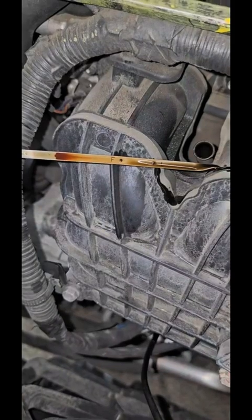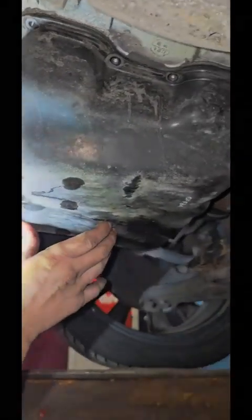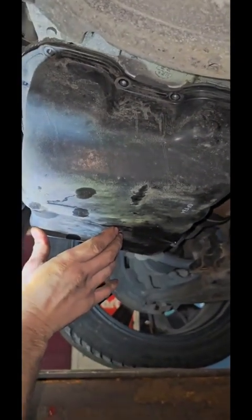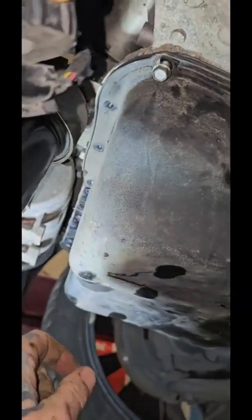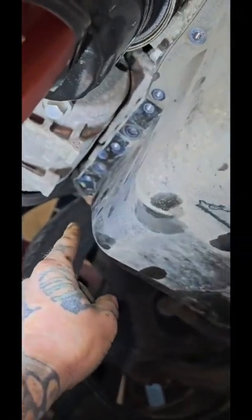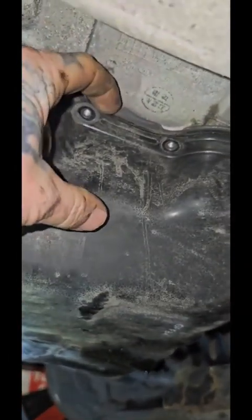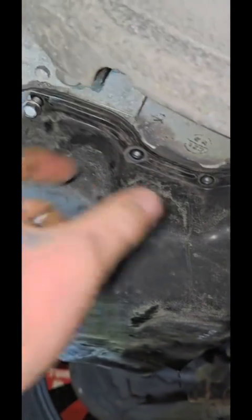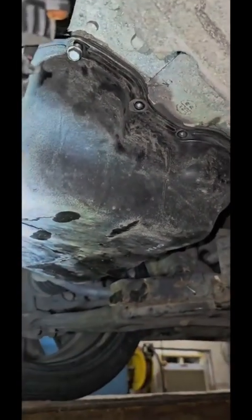Wondering — she does have oil. All right, we're pulling the oil pan on the Hyundai; we're gonna see if we got any rod bearing damage. Here's a pro tip for the new guys: leave a couple bolts partially unthreaded. You see how it's siliconed like this — you don't want to have all the bolts out and then pop it down, even though the oil is drained.